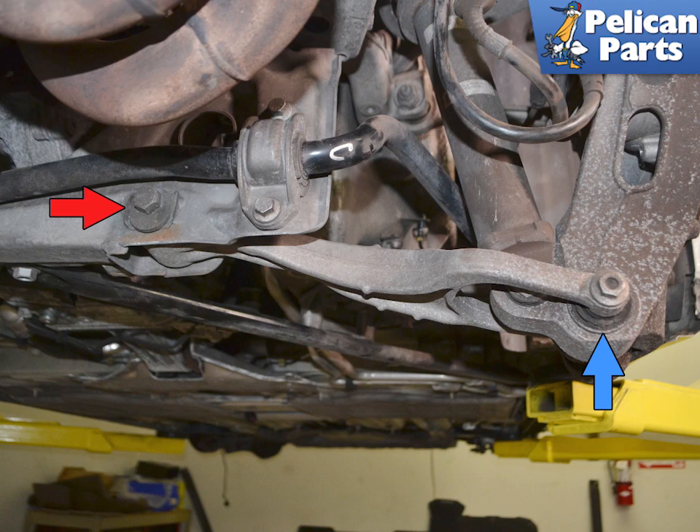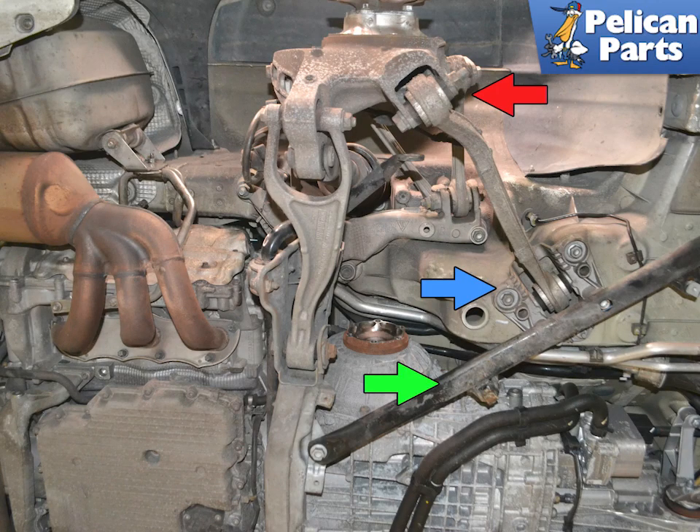The wishbone goes on both sides of the wheel carrier and needs to be removed to change the shocks. The lower diagonal arm connects to the wheel carrier and then a mount that connects to the chassis. When servicing it, you will need to remove the diagonal brace.